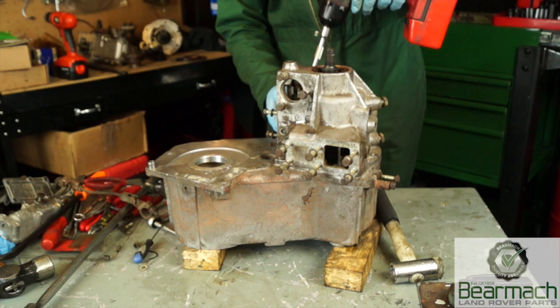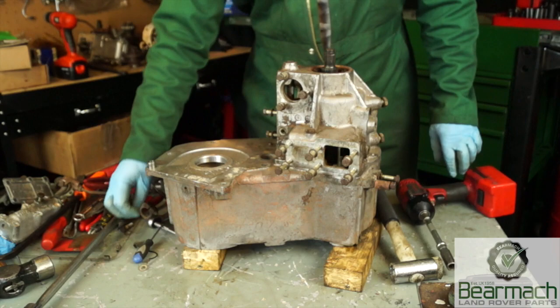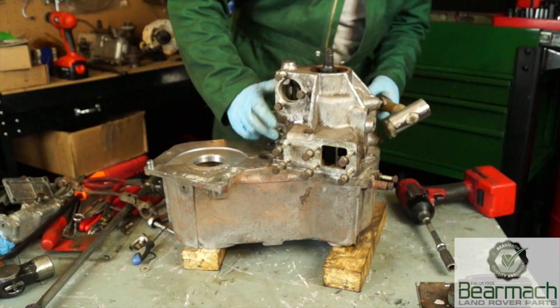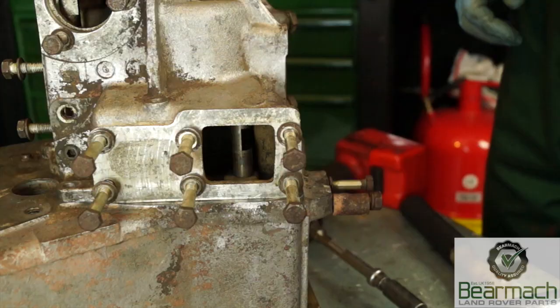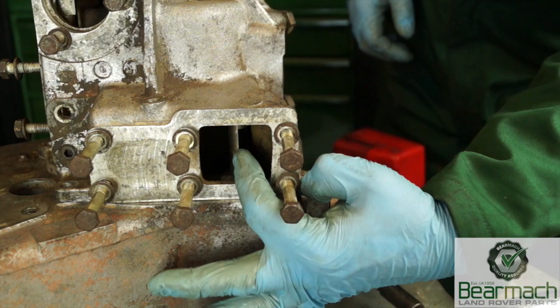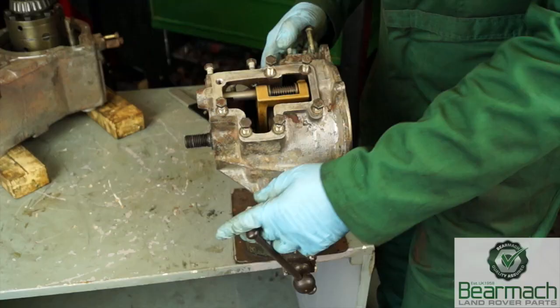The front casing is clamped to the main casing by a series of M8 bolts — they'll all have 13mm heads on them. Be aware that when you remove it there's actually a bolt at the top here — I'm pointing to it with an arrow. Always use something like a soft hammer to break the gasket seal; don't use a harder hammer otherwise you'll end up cracking or denting the casing. Once you find and unwind that bolt you can then lift the casing off. Underneath you have the selector rod for high and low, and the center differential unit of the transfer box with bearing.